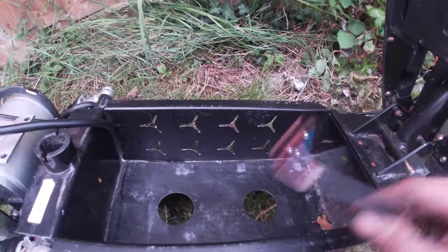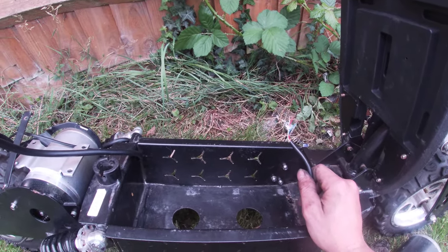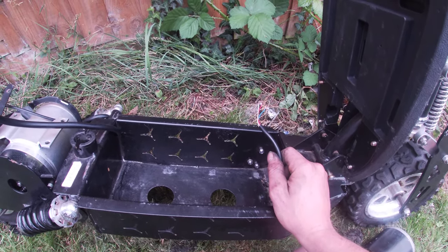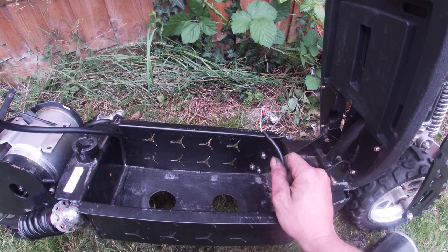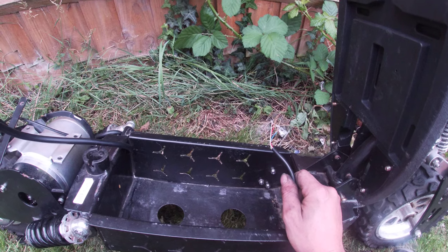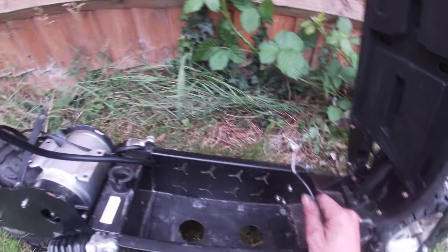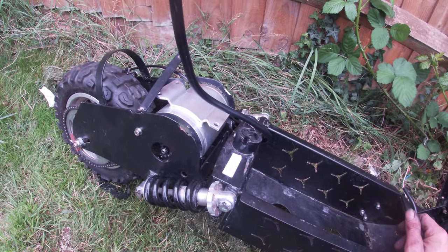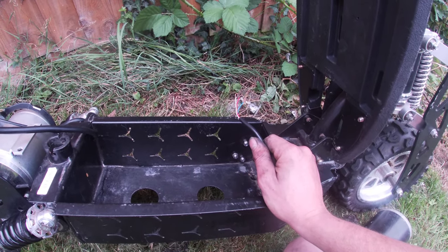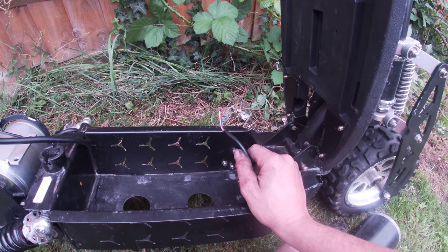There's your battery box, and there's no controller in here at the minute. I'm waiting on a controller coming because the one I had in mind was dead as a doornail - an 18 FET with some visually bad FETs in parallel. It destroyed the pads so you couldn't put new FETs in; it destroyed the board. I tried to run it anyway and it chose that moment to give up with this extra motor in the Indy S1 from last video. The motor had done about three rotations before the controller just went: nope, I'm done. Bang.